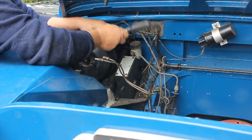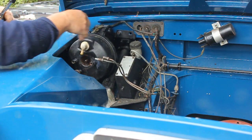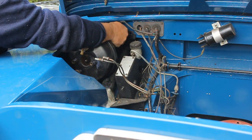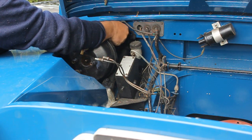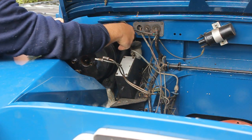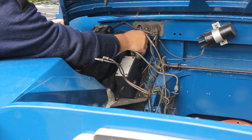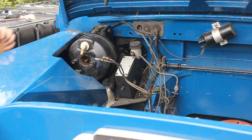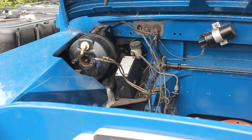Basically they've got a weak section in the wall that wrinkles and compresses when you pull, so the threaded part stays intact, but then this waste piece collapses and pulls up tight in the middle of the hole, taking up any gap and pulling it against the swage on the outside. They're a clever little thing.